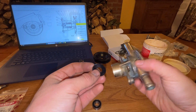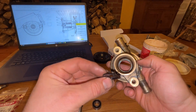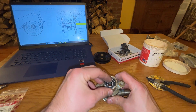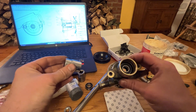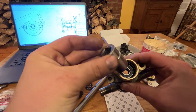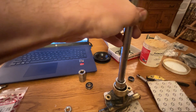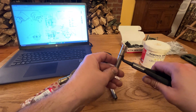We're going to put this little plastic washer in through the back where the pulley goes — make sure the four little tangs don't hit the recesses. Next we stick the bearing in, then the smaller one. I need to get a hammer and knock that in with a socket. I've got a socket that sits nicely over the bearing on the outer housing and we're just going to punch that in using a bit of force, making sure we don't score the shaft.